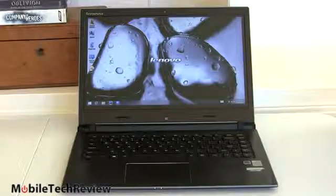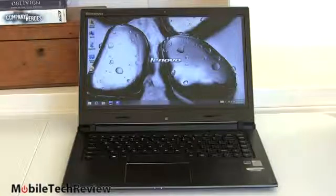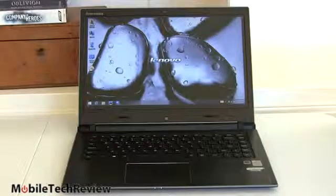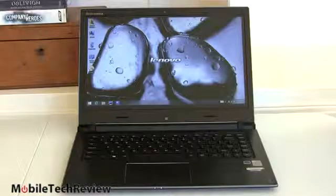This has all the power of an Ultrabook with the ULV CPU, starting with that 1.6 gigahertz Core i5 4200U that we have here. You can get a Core i7. You could go down to a Core i3 and lose your turbo boost as well. Certainly it can handle some video editing, Photoshop editing, MS Office, no problem. Web browsing, multiple tabs in Chrome, just fine. It's your everyday capable PC.